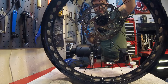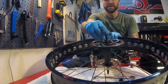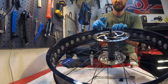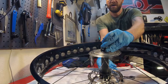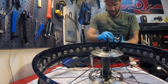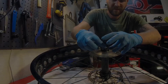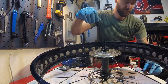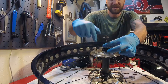So you'll see they are stuck in that grease. And what we do is we're going to take that spindle and we're going to drop it through, put those through the other side. And I just wiggle it side to side and that actually seats all the bearings in the outer race. Then, very carefully — you don't want to get grease on your rotor like I said before — hold it and flip the whole thing over. Set it down on that and that will hold those in place while you do this side. So those are all seated in there. Now, you're going to take that cone nut. We're going to thread it down on here and be careful not to knock any of those bearings down inside of the hub while you do this.